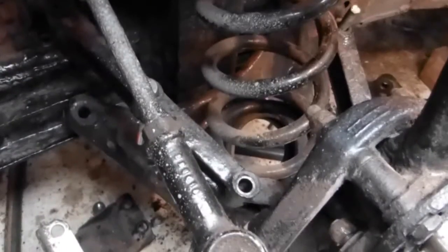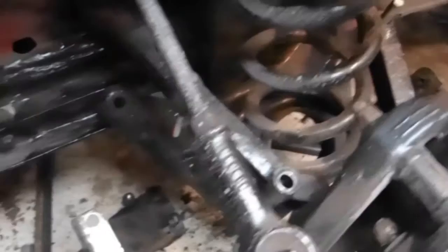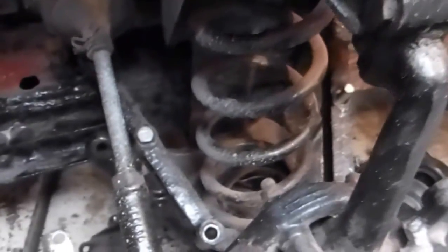The scissor jack is right under the centre of the threaded bar. It's now loose at the top so I can take that off completely, lower the jack, and take that off. Lowering the jack should bring the spring pan right down. There's the lower spring pan out — just a couple of taps with a hammer and that's it all loose, ready to lift out.